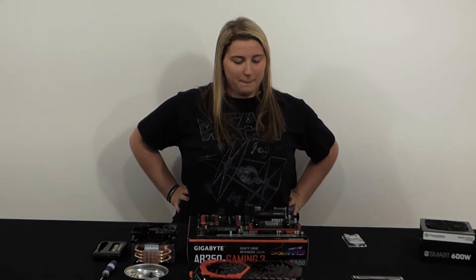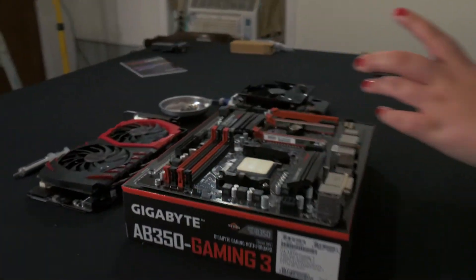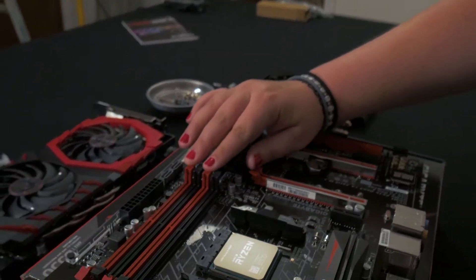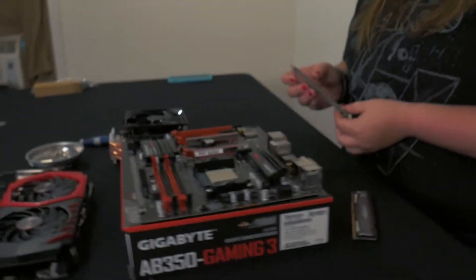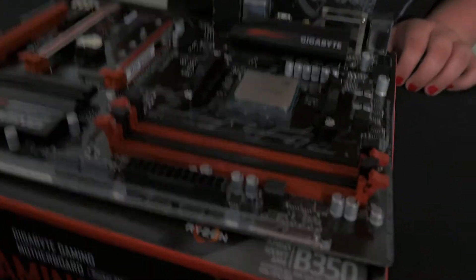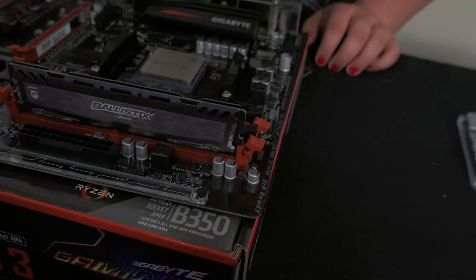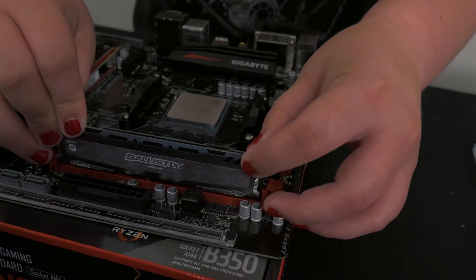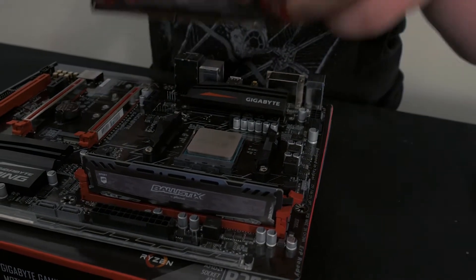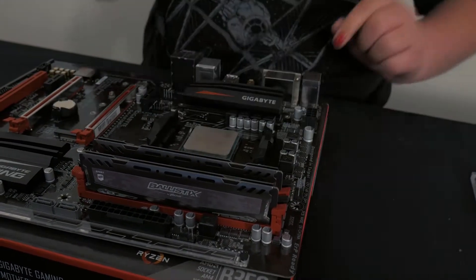The next step that we are going to do is take these RAM sticks. First, you're going to want to open up the two red pull tabs right here — pull those back on that side and the same thing on the other side. Now line those RAM sticks in. It does matter which way — line it up with the notch right there. Only goes in one way. It does take some force, but push real hard all the way. You got to click that side of it. There you go. And the other one, same thing. You just put in some RAM.